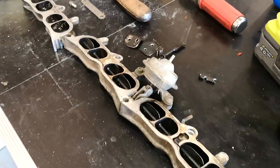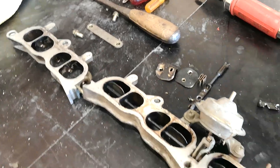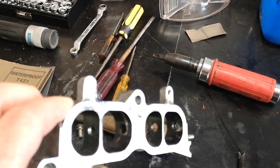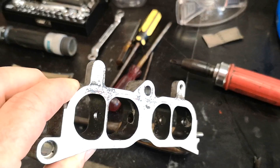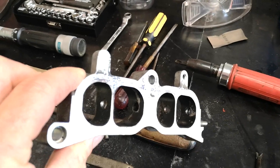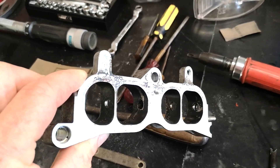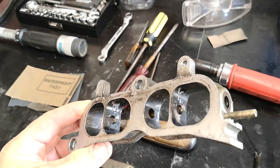I'm just starting to pull apart this butterfly system because my plan was to use this just as a spacer in behind the manifold. Now I've stripped this part down. The concern - and I might ask a question on toy mods - is those holes in there. So after it comes in the intake side and channels down through the manifold, we've got our individual intakes going to individual cylinders. These holes in here - have people used these and done this before? What have they done with those holes? Have they plugged them up, or does it create a bit of balance in the cylinders having those holes there? Be interested to know your feedback.